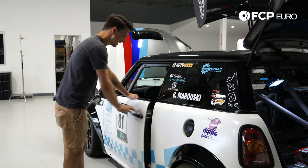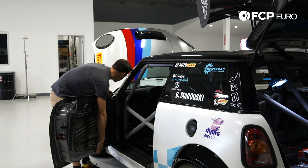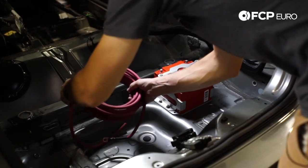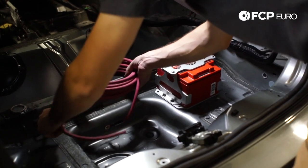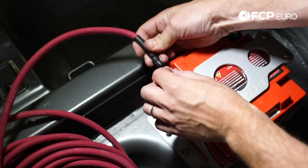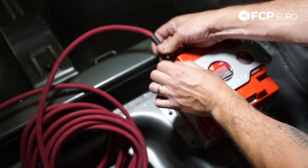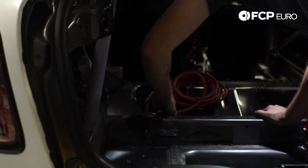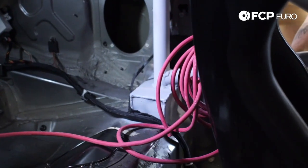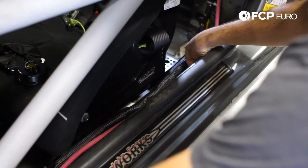One beautiful thing about working on race cars is typically they get worked on a lot, so ease of working on it matters. Now with the first attachment point made to the cable, now is the time to mount it to the battery and determine the routing through the car. This is a good time to think about: if you have a car with an interior, you may want to pass it underneath the carpet. If you have a car with an open interior like this, you want to make sure it's not going by any sharp edges. Also make sure the cable is tied down appropriately and not loose across the floor.